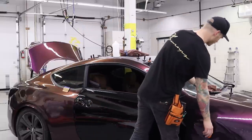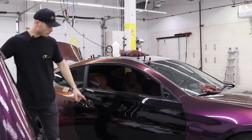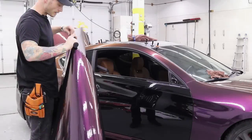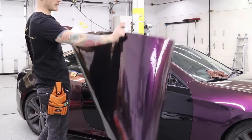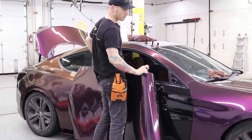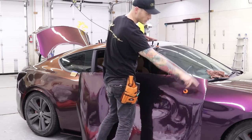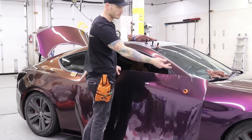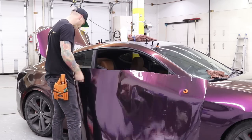So I already have the door cut, as seen in the other video. The panel is already prepared, and we're gonna wrap it. So again, what we want to do is make sure that we're running this film directionally. This means not turning it upside down 180. We want to keep it all exactly the same direction, 100%, as much as possible. Now, again, that won't happen with the hood. The hood will run a different way compared to the bumper or the fender. The hood actually runs across. But, I mean, looking at it, it matches up with the fender afterwards. We'll do a walk-around video to show you guys what all of this looks like when it's all finished,